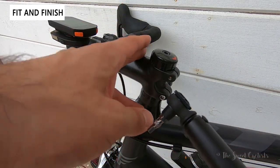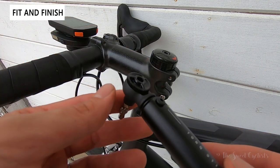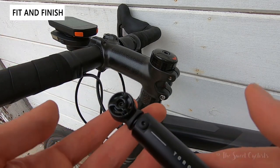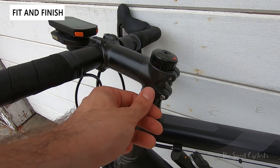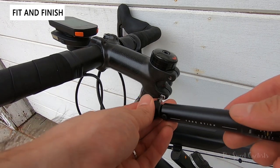The great thing about a bike is everything is either a 3, 4, or 5 Allen bit. And most repairs are simply handlebars, stem, seat posts, little things you adjust. And they all have usually low torque values. So Torq Stick is perfect for this. My Easton stem here says 5 newton meters. So let's see if that's up to torque.